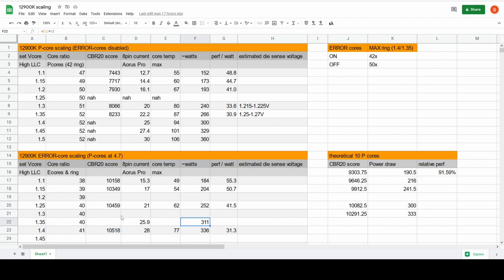So yeah, I guess if you have workloads that would be better suited to running on a 5950X... well, no, I would not do this, because you're going to have a hell of a time cooling it. This is already hard enough to cool as is. And so the way I would approach E-core overclocking is max out your P-cores, and then whatever the E-cores happen to do is whatever you stop with. I wouldn't put too much time and effort into maxing out the E-cores. They don't go that high.